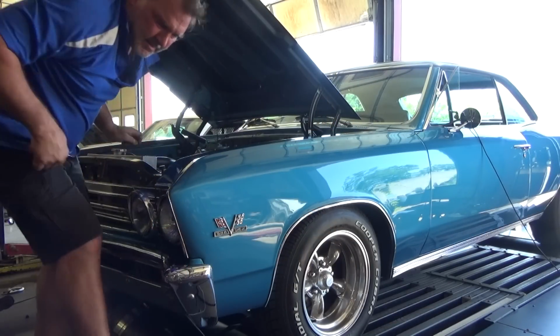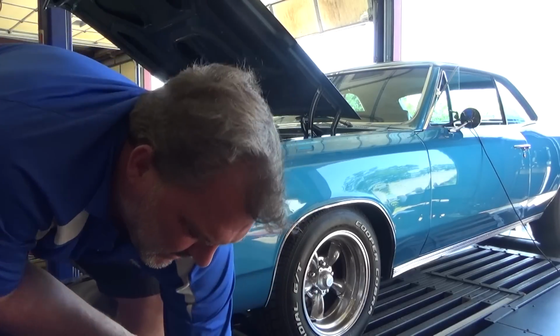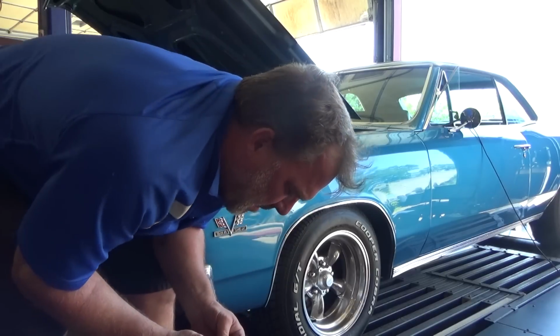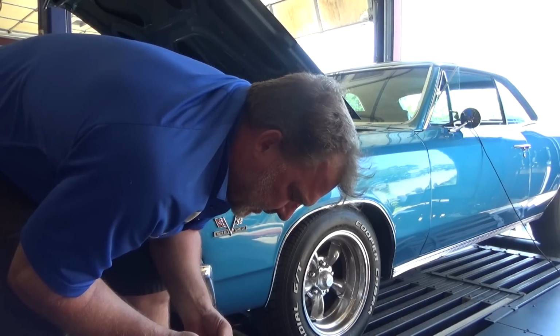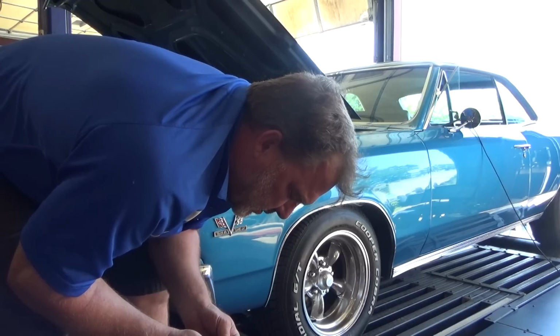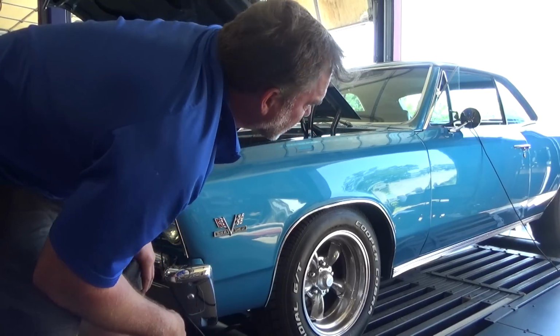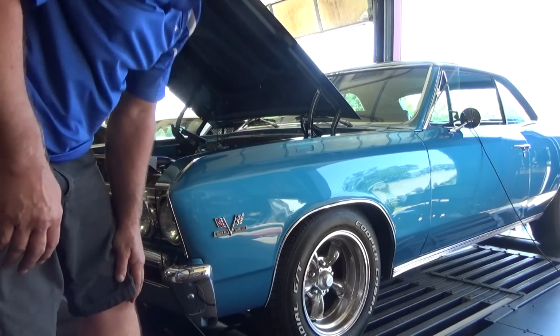We're going to try that. I just turned the brown cam around because I think I had it in upside down, because I have it on the 2, but it says 1 on it. Yellow cam I think only goes in one way. I didn't think you could put the brown cam on wrong. Let's see what that does to our graph. And then we'll throw 2 more degrees of timing.